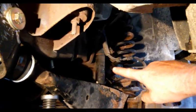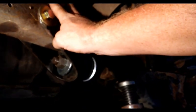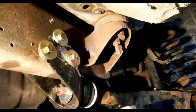Now this is the driver's side — from what I can tell, the driver's side is supposed to be a lot easier. Leave that on, just cut these off. The tension is off because the spring doesn't have any weight on it. This bottle jack is here just to help hold the weight of the arm. Once these are cut, you tap each of those out and this will just slowly drop down. Make sure you undo this first before you do all of this — get this loose, busted loose — and then start working cutting these off. This is the twin Ford twin I-beam suspension for the 1995 Ford E250 van.